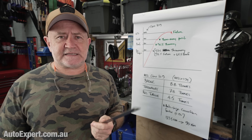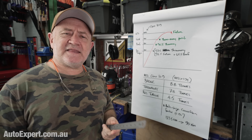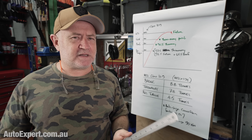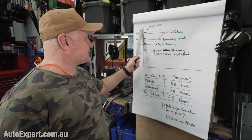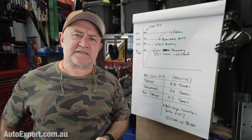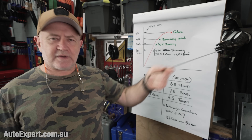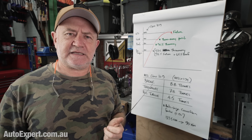This is the roadmap to catastrophic failure of anything made of steel. We want to know where failure is so we can avoid travelling there with our designs. The question really is how far is the minimum safe distance from catastrophic failure in design — and that's what bolted joint design is all about. It's about being conservatively far enough away from failure that the possibility of going there is remote. This is stress and strain — think of it as how hard the nut is stretching the stud, because the thread is basically a big ramp, and its only function is to allow the nut to creep up on it and drag tension into the stud.